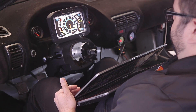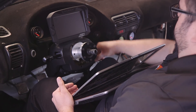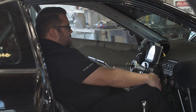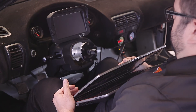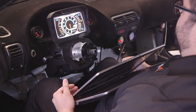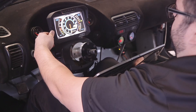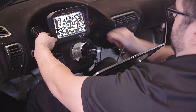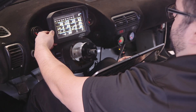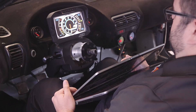The dash reboots. The one thing we will need to do is actually power cycle the car in order to get the ECU to reset and start transmitting the data over CAN. As you can see, we've successfully loaded our layout onto the dash. We're going to run through the different pages here — second page, third page with our lap timing info, which is counting up right now — let's reset that. And our fourth page, the diagnostic page. From here, now we're ready to start the engine and go out and drive the vehicle.